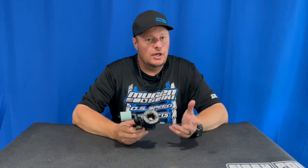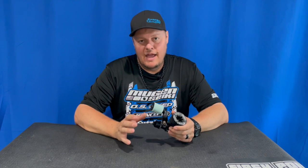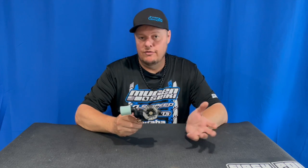I did a video a long time ago where I talked about compression and knowing when your engine is worn out — and if the engine holds itself up, it's still good. That video was helpful for a lot of people, but it also freaked a lot of people out. Because you may have an engine that's running and operating perfectly, but you happen to do the test and it doesn't hold itself up and you freak out thinking your engine's worn out. That's not always the case, and it's the same thing with the bearings. If you notice a little bit of seeping when the engine is sitting, but the engine's performing and running great on the track, it's not something to freak out and worry about.